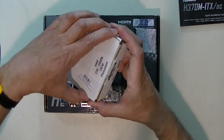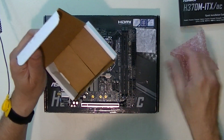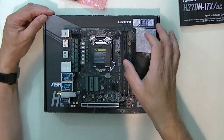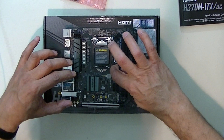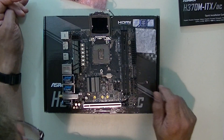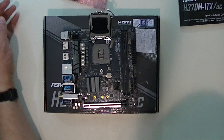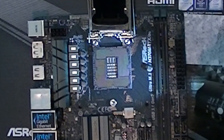Let me start with the processor chip. Even though I'm installing the processor now, I will not be putting the cooler on yet, because it's going to use the all-in-one cooler I showed earlier. I'll open the CPU socket by pushing down on the spring lever and over to the side. The delicate part here is all of the pins, so I will not touch those. At a quick glance they look okay — let me get a flashlight to double-check. I don't see any unusual reflections, so it looks good.